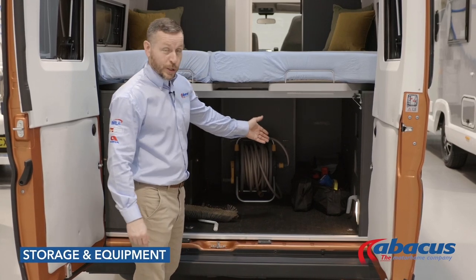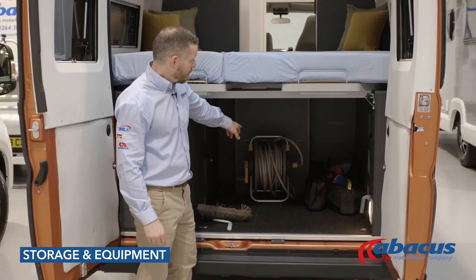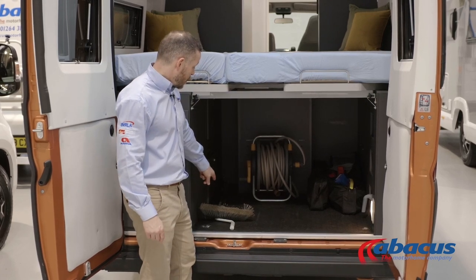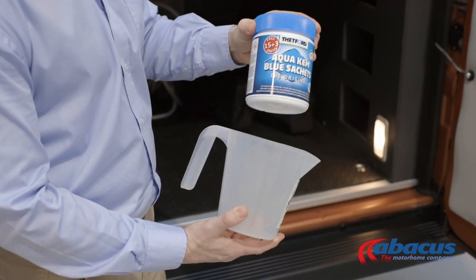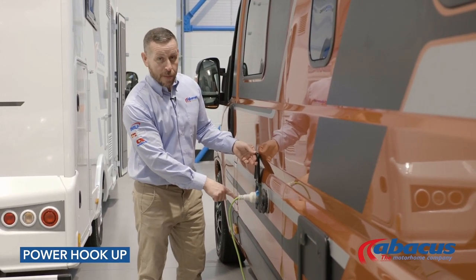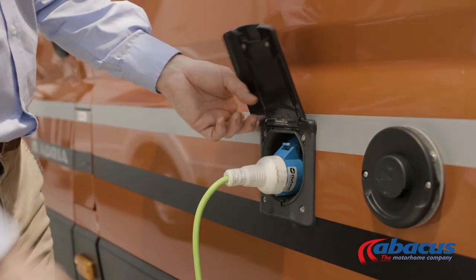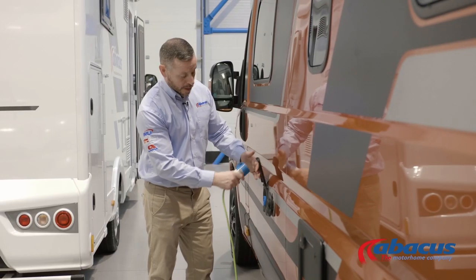In the storage area of the vehicle we've supplied you with a mains cable for 230-volt connection, hose for refilling your water supply, kit bags for breakdowns, high-vis jackets, warning triangles, breathalysers, levelling blocks, dustpan and brush, broom, awning handle, and also the tablets for your toilet. To connect to the 230-volt power supply on a campsite, make sure the lid always goes in first, press the rest in, make sure it's secure, and close the flap down. To remove the cable, give a sharp pull and replace.